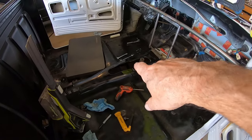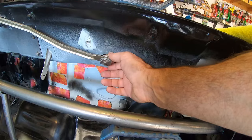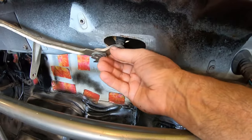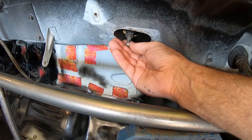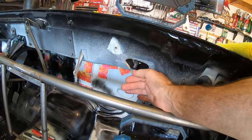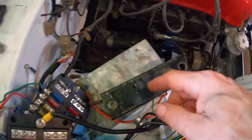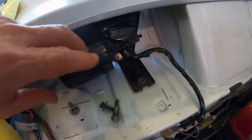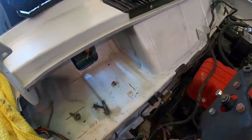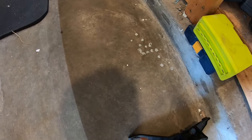Okay, so I finally got the floor all painted black. I even painted underneath that cover, got all the plugs in. I've got to address this wiper mount — I just took all the bolts out. I don't know why it sits so far away from the hole, but it just introduces a huge gap. I don't know how I want to fix this because I'm not going to be able to find a gasket. I've got another issue with this wiper mount — I could just redesign this bracket and pull it flush. Because I'm working on the fuse boxes, I'm going to put two fuse boxes here. But I need to cut this thing off — this wiper is just wasting too much space. It doesn't need to be a bracket four inches long. I could easily move the hole back.